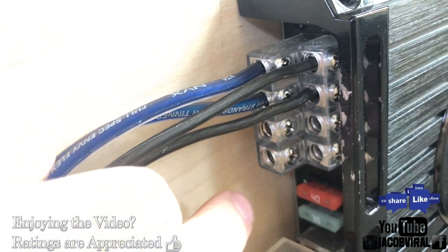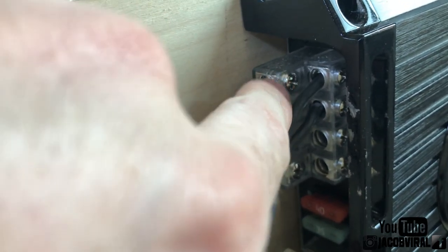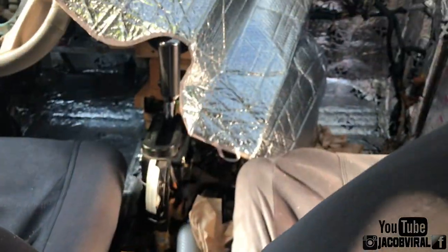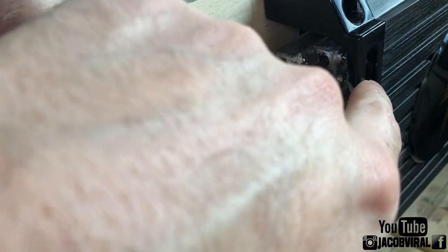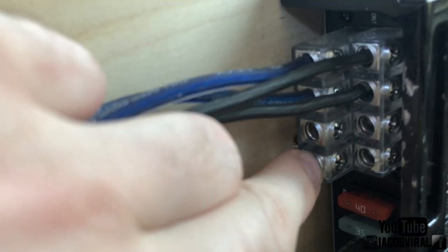So just before I go into detailed explanation and testing — I just have some six and a halfs up front and some six and a halfs up at my dash area. That's all I have run. Both sets are wired down to two ohm, so I'm only using two of my channels at the two ohm minimum of my amplifier. That means I'm getting the max power out of two of these channels, but my other two channels don't have anything connected.